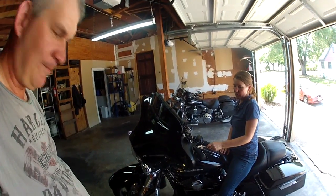If you look way up under here, let's see if we can do it. It's easier actually on our other bike. The top one, it didn't come out of the top one. This is going to be hard to see, real hard. I'm holding the camera. Right up there is the grease at the top. I'm going to try to pump this with one hand, and you'll see it start coming out of the top section as well. There it goes. You can see the bead of grease right up there, and that's how you want it on both ends. But that was it. That's all you do.